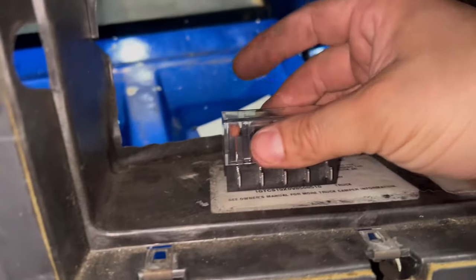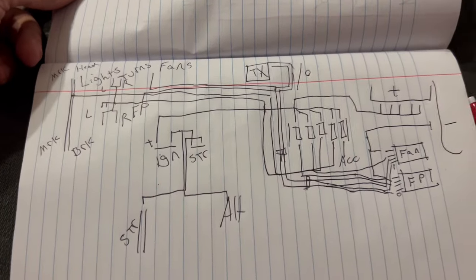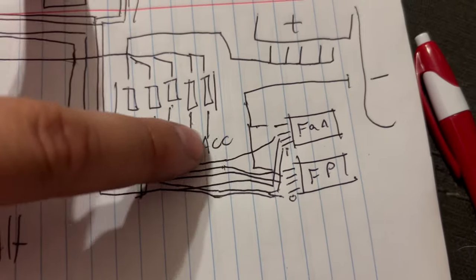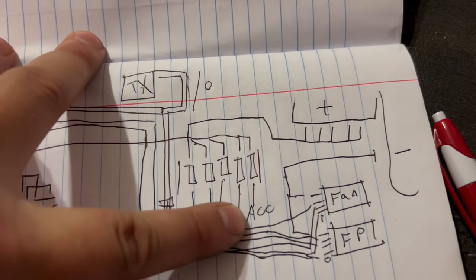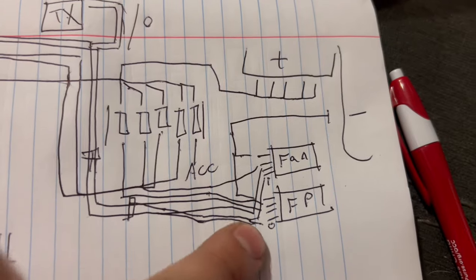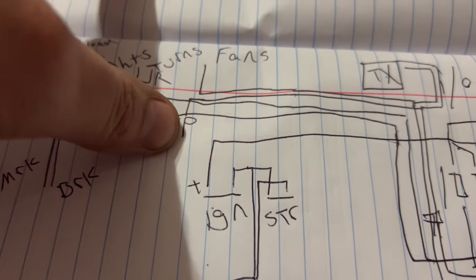I think I'm going to put it there — it's mounted and it's not going anywhere. This is the fuse box in the glove compartment. This is the distribution block that is under the dash — comes over, goes to the fuses, and then what needs to go to the relays for the fans and the fuel pump. I have the Terminator sending the signal wire in here, the ground goes to the side of the cab, and the output goes through the dash over to the driver's side fans. Fuel pump goes right here.